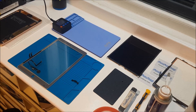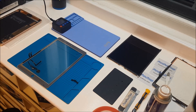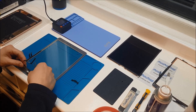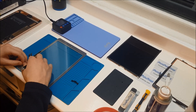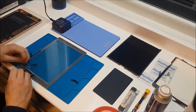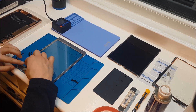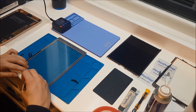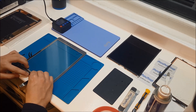What we're going to do with our new digitizer is tape it up and install the home button. We've removed the stock tape because we believe it isn't strong enough to stop things like the iPad digitizer lifting over time. So we tend to tape it up with our own tape and then install the home button. Then we get the bracket from the original digitizer and line it up with the home button.